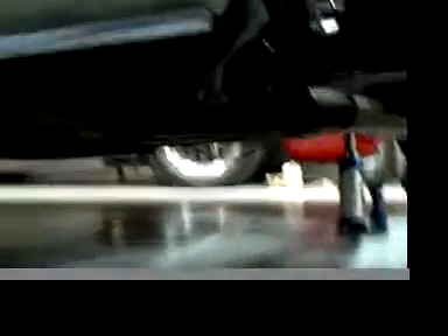In order to improve safety and lessen pedal application pressure, an electric booster system was installed by ABS Brakes of Orange, California. A new single circuit booster is remotely mounted in place of the original vacuum booster and connected to the master cylinder with a braided steel line. This electric booster can supply about 1700 PSI pressure, or about 500 more than the original vacuum booster.